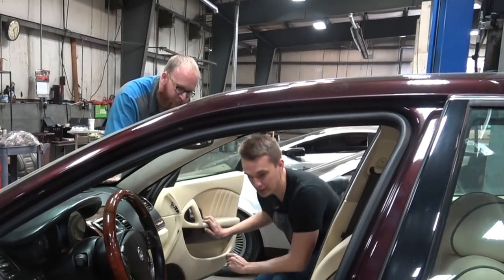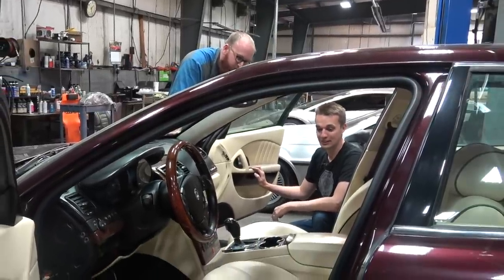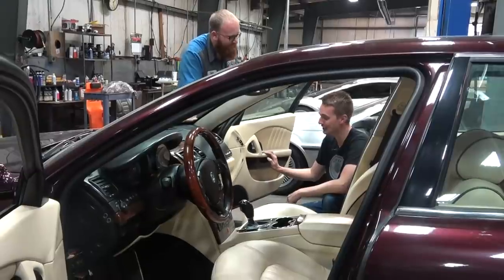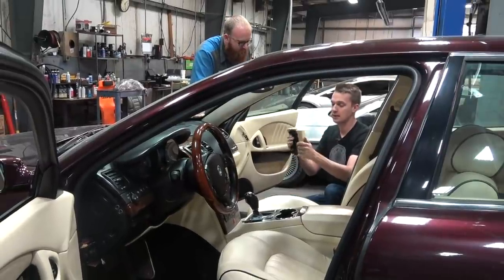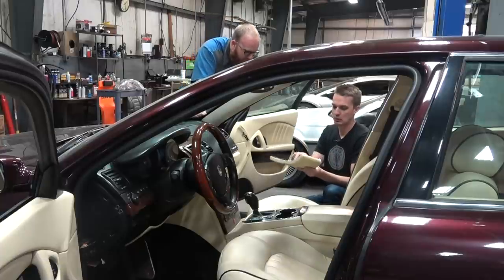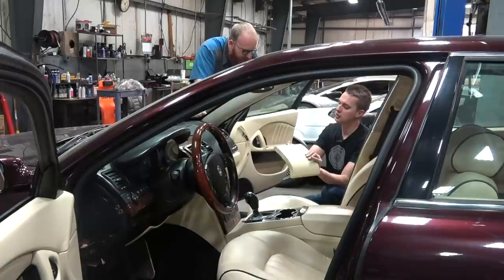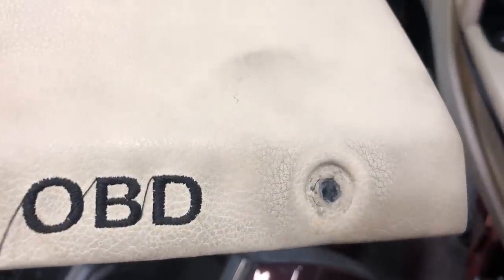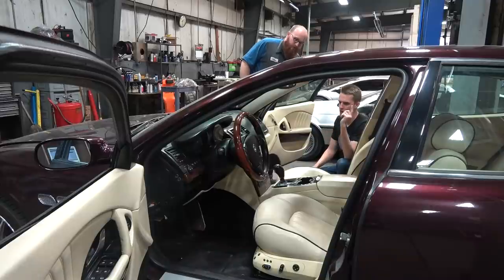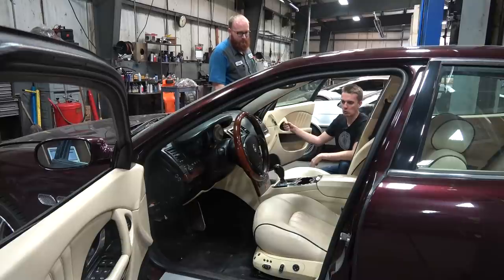Feast your eyes on this beautiful interior. The coloring in it is just beautiful. You don't see that on a Kia Rondo. Unfortunately it is pretty warm. This is the OBD2 cover over on the driver's side, and it looks like some clips are broken and they've held it on with Velcro that has now fallen off, so it's kind of permanently off. But look, they even stitched in OBD right here. Not even a sticker — it's stitched. And I'm also having a fault code for the parking brake. It has an electronic parking brake. It says it's not working, and the battery will go dead if it sits for more than a few days.